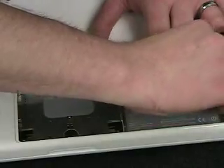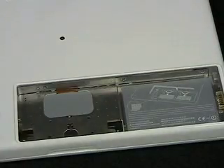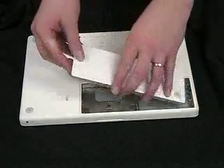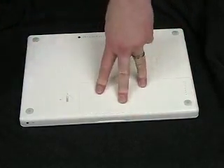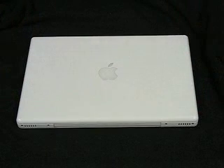These screws are really small and they're pretty difficult, but with some practice you can do it. And that's it. After that, you want to get your battery again, find this interface — it goes right there. Just slide it in, push it down, hold it down, use your penny again, slide that back into the locked position, and you're good to go.